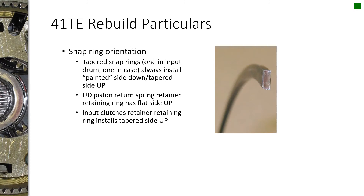These transmissions have a few tapered snap rings. The taper is sometimes hard to see, but they taper the outer edge a little bit. The idea is: in the input drums and in the case, there's a flat snap ring on the bottom that fits inside the case or input drum assembly. A plate with a step fits on top of that flat snap ring. So they don't have to get too precise when cutting the grooves — they purposefully make the top groove a little bit looser than needed.